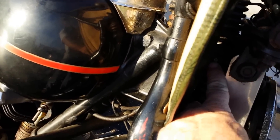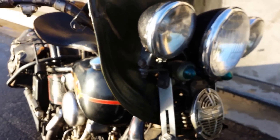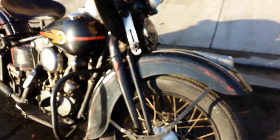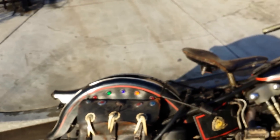And the little zert here, where my finger is — you can see the zert right there — it's on the outside. Early 38 and prior had it on the inside and back of the headlight. So the fork, the fenders, the oil tank, all are definitely original paint.